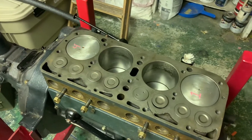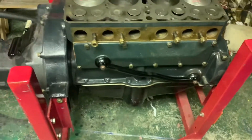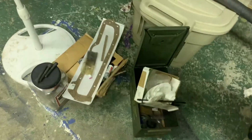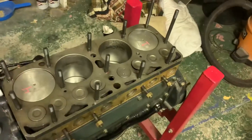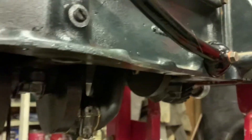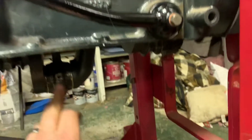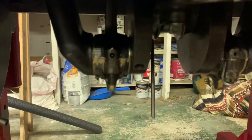Putting the motor together right now, putting in new studs - here are the head bolt studs, going ahead and putting them in. Got the head ready to go on. Put never-seez on all the threads. Going through the connecting rods - cylinders one and two are done and torqued with cotter pins, but when I torque number three it locks up.